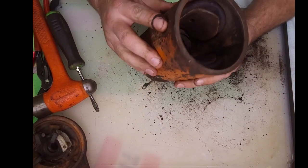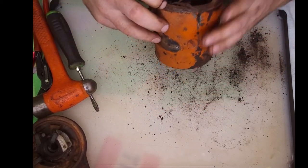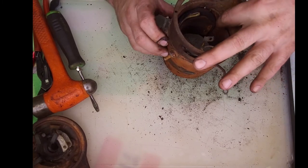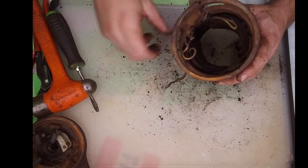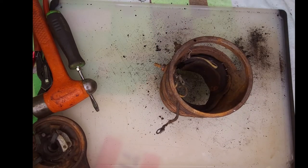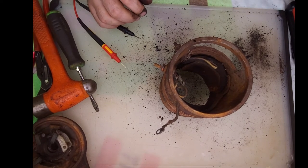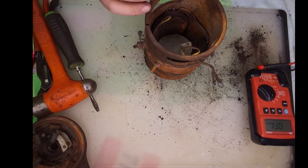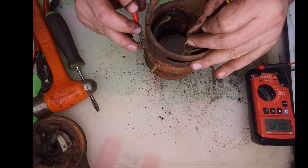Let's take a look at the field coils. Well, they look okay. I can do a quick electrical test. I don't know what the spec is - I have not looked this up yet, but when we do the assembly video I'll definitely test it out and have some specs. We'll put this on ohms - it should be between the field coils. It should be low, close to zero I'm imagining. Yeah, 1.7 ohms - that's fairly typical, but I'll need to look up specs to be sure.